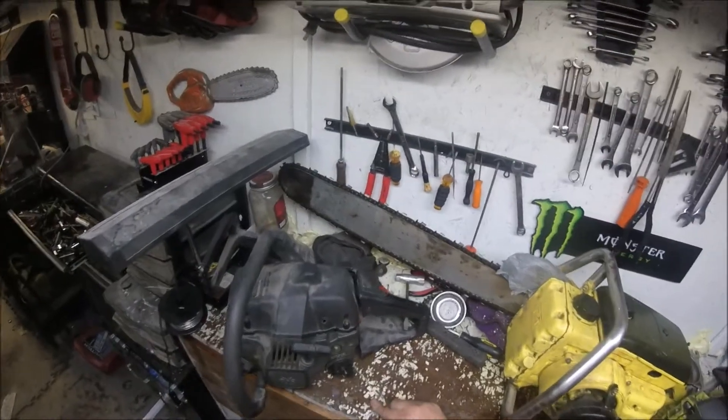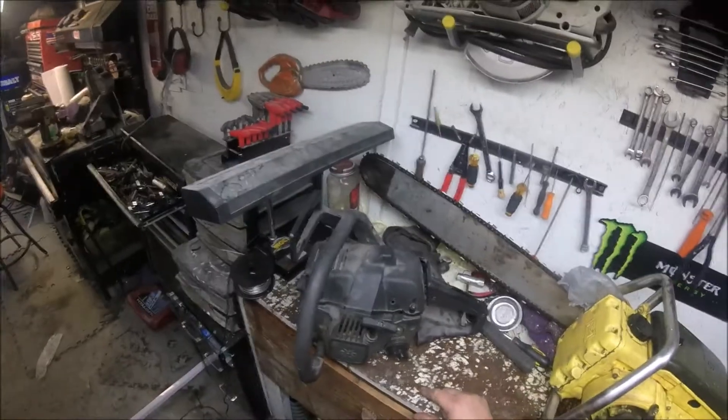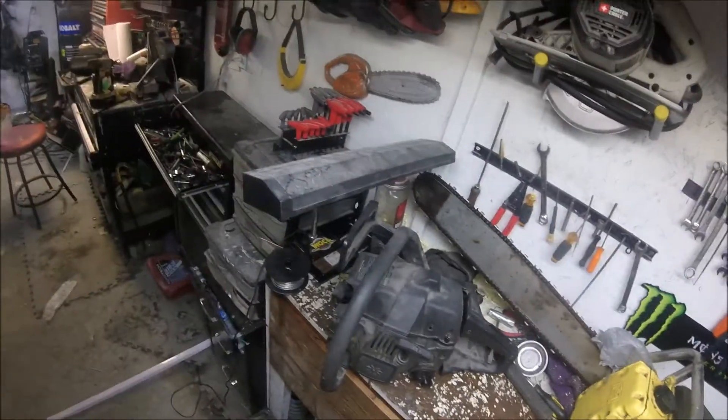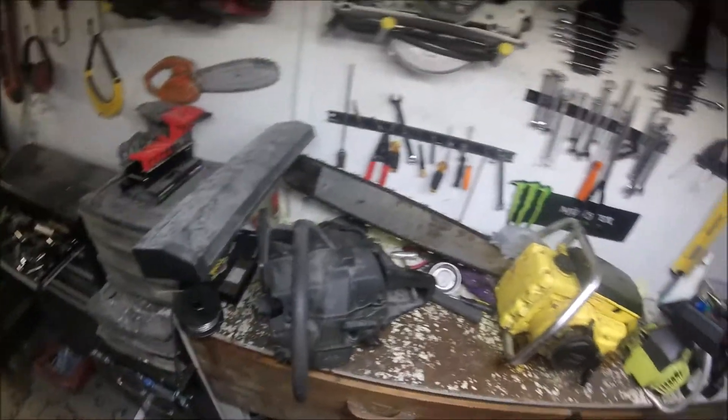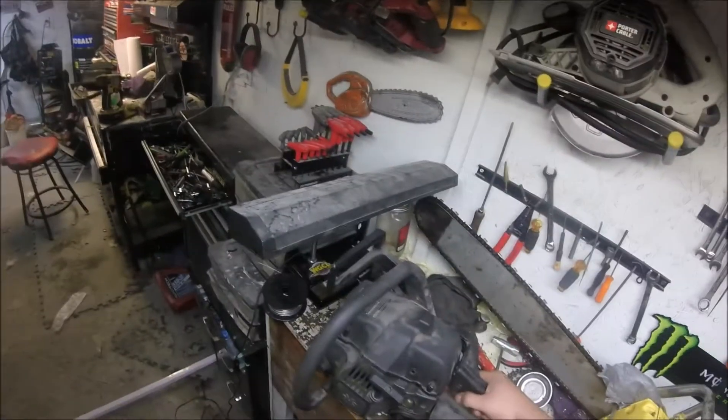The transfers were raised a little too high — I think around 116 to 118 degrees when they opened. I'll start it up and let you listen; the thing does cut really well. It's 42cc, but it just gets really hot.